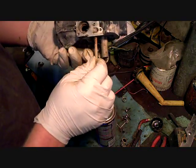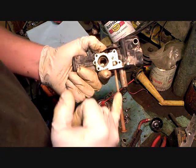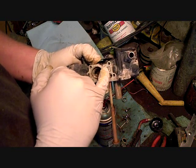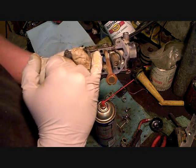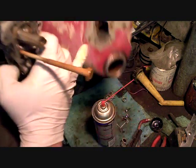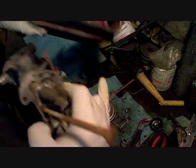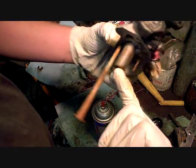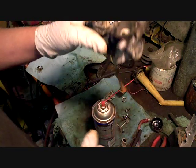What it does is it pulls gas up from the bottom of the tank, up through here, back out through here, drops it back into the gas tank — into the upper bowl right there. That's only about an inch and a half deep, then the carburetor pulls it up through the main jet, up into the carburetor making the engine run.